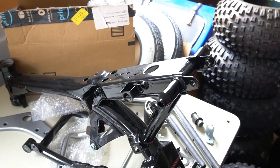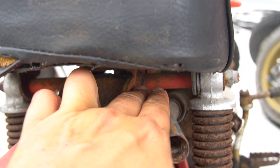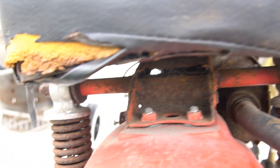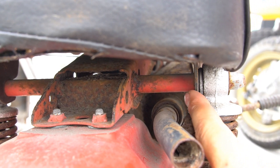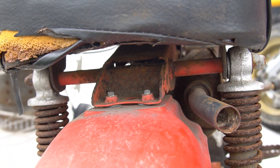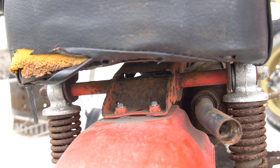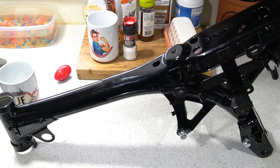Those later Z50R mounts tend to be tweaked up, but these seem to be much more durable. I prefer to collect these soft tail frames because I think they're a beefier design when it comes to the rear shock mount. To give a visual: on a Z50R, the later frames just had studs threaded on both sides - pretty weak in that area. I always see these bent up from jumping or heavier riders. That other frame has a through hole where you run a big stud through, which reinforces that area.